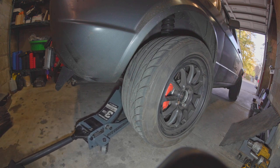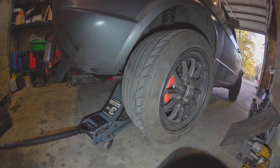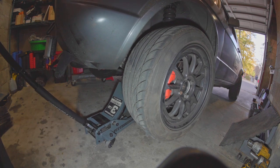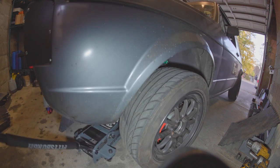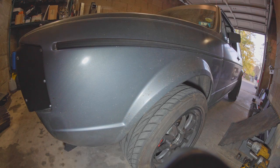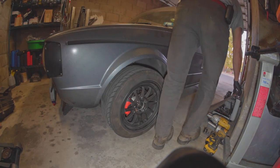Because it was just this one side that was loose, I just re-tightened the other side with some Loctite, but it was still tight. There's no way I'm pressing the other side for no reason, so I'm just going to hang onto that extra wheel bearing. It's important to say that at least these bearings right now, with the car's weight about to be on them, are already somewhat tight. They're not final torque spec, but at least somewhat tight. I think if you even just set your car down on bearings that had no stub shaft bolted to them and no axle nut, it would ruin them immediately.